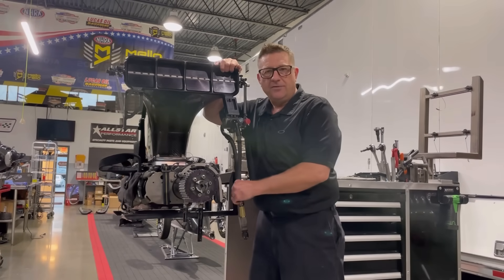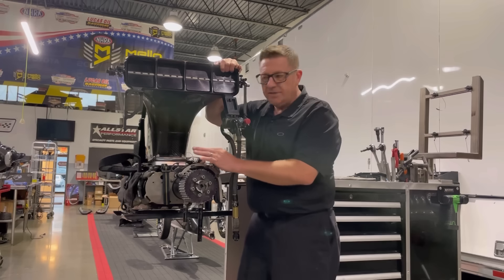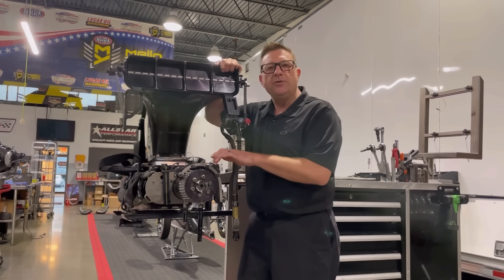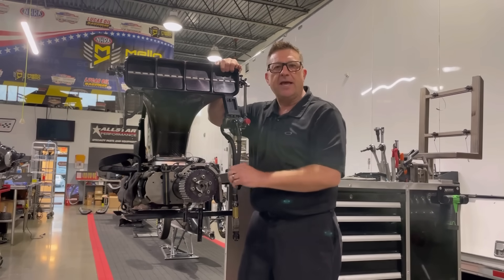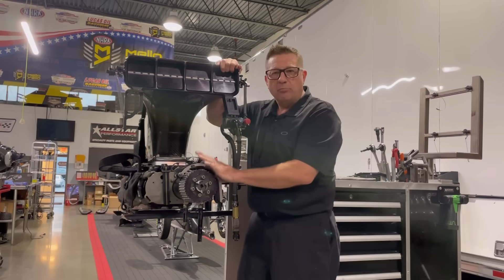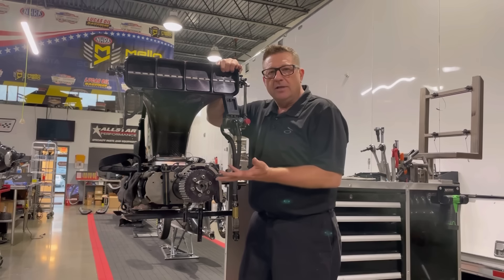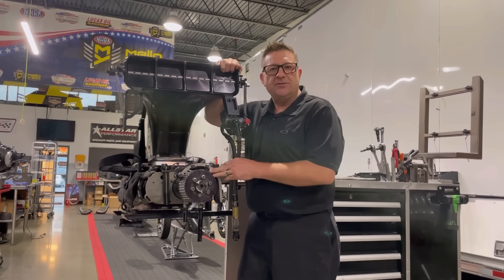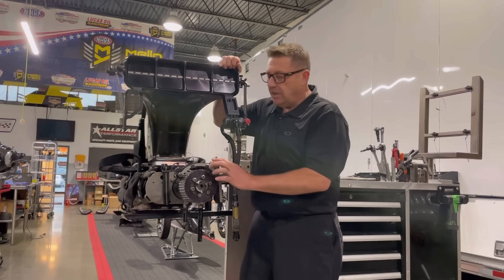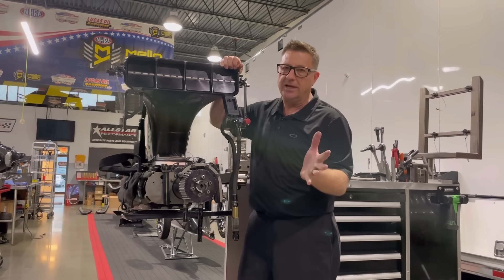So that's how you save a 10,000 horsepower nitro-burning supercharger. A lot of teams wouldn't have gone through that effort to fix the blower case and that kind of thing, but this actually came out pretty decent. The only thing I don't like about it is the amount of plastic sticking up on the OD of the rotor — it should be higher so it has better contact in the root of that blower rotor on the other side. But there's nothing we can do with that. It's an old case; the bore on it was different from the very get-go, and the case has probably had a bang or something that knocked the bottom of that case up a little bit. Generally I would never sand a case like that, but in this instance where it's not going to be a top-10 blower needed out on the nitro circuit, this thing's going to work just fine. I hope you enjoyed the video — there's so much more work that goes into one of these things than anybody realizes. Thanks for watching.